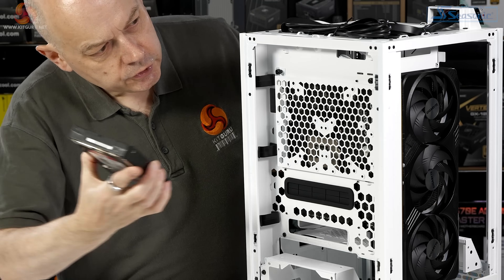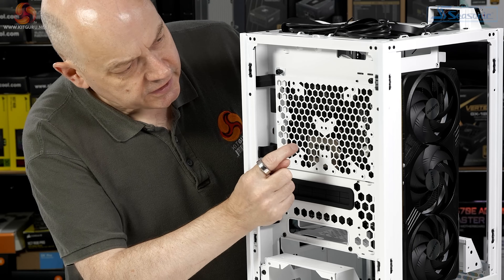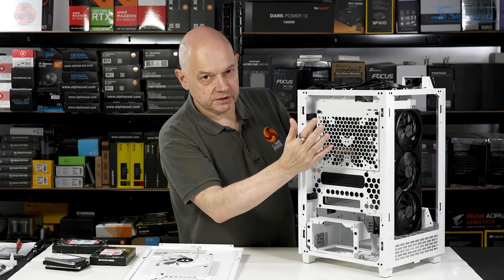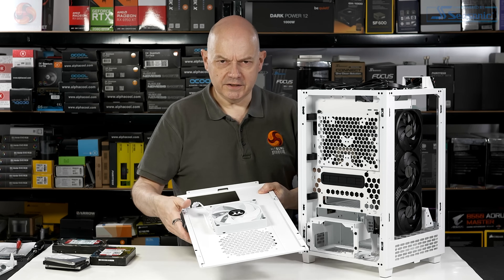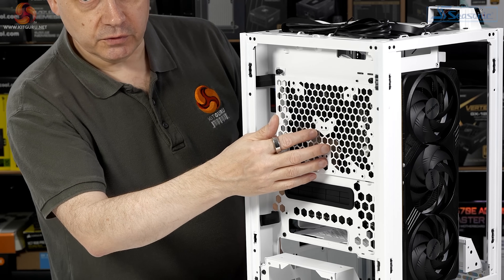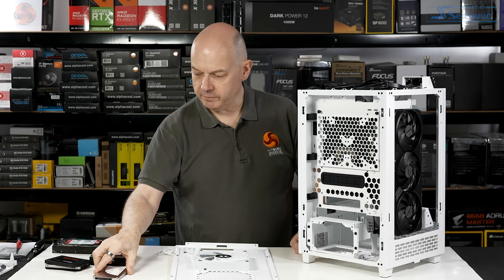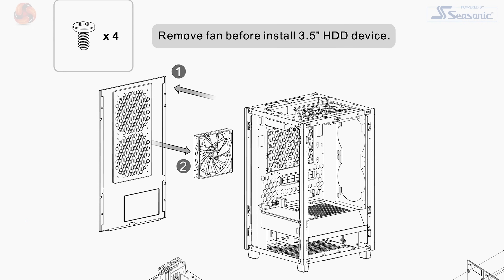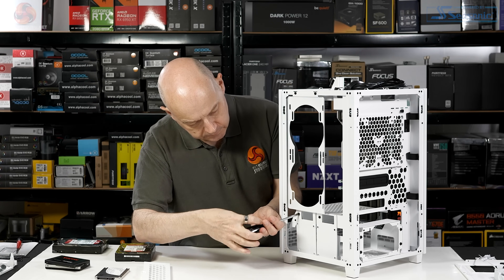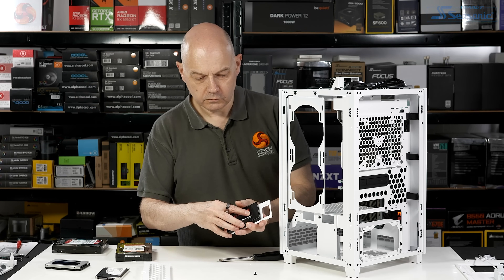There's something slightly odd if you look closely. We can install either two 3.5-inch drives or two 2.5-inch SATA SSDs — that much is fairly conventional. Curiously, there are also mounting holes for a 120-140mm cooling fan, which would sit directly behind the motherboard tray. But this back panel already has a 140mm fan installed. It looks like Thermaltake basically changed their mind — there's a stamping which can be used to install a fan, but don't. Use it for storage instead. Also, if you wish to install hard drives rather than SSDs, you won't have enough space for the rear fan, so that has to come off. Once you remove the lower cover, you have access to a conventional SSD mount.